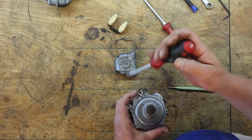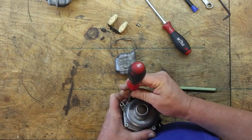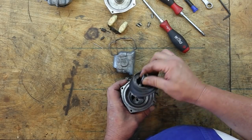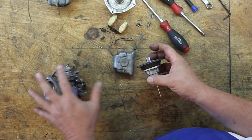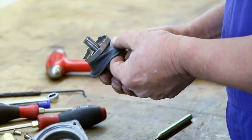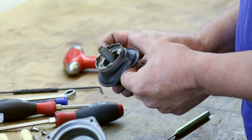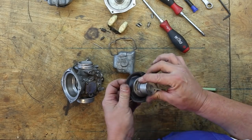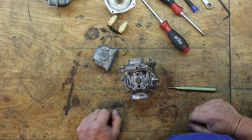At this point I'm going to go ahead and take the tops off. Now we're probably going to just replace these, but they actually don't look too bad — looks like they might have been replaced. You want to pull on them and make sure they're really pliable and that you don't find any holes, so you don't have an internal vacuum leak. Kind of inspect them — they actually don't look too bad. With that part out, it's easy enough to lay this flat on the bench, which makes it a lot nicer to work with.